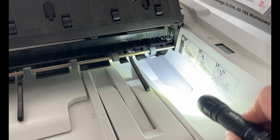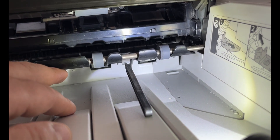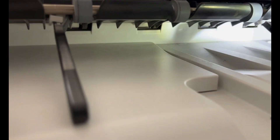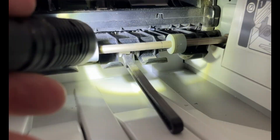So I begin the search for a potential fault. I check whether all components are in their proper place and make sure none are dislodged or broken. I also inspect the machine for any bits of paper that might be obstructing the path of the original — looking for any foreign objects. At this stage, a flashlight is essential.